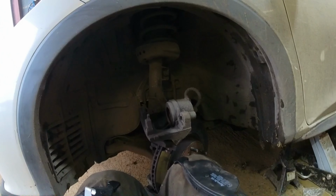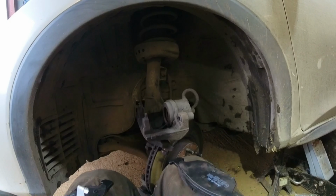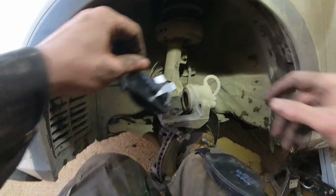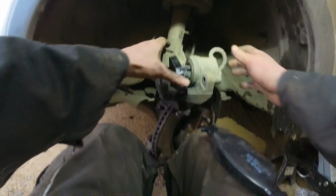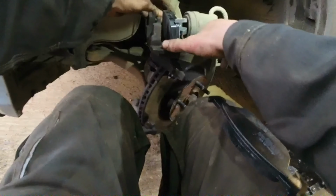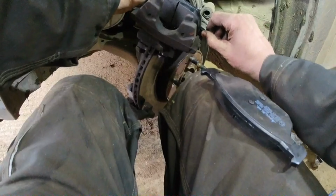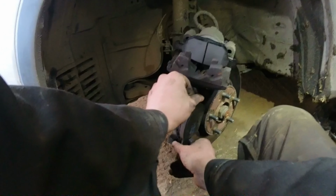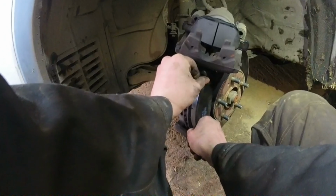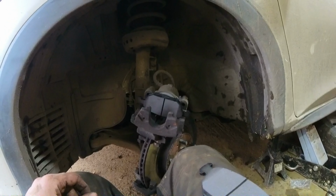So we stick that in. Make sure we have no grease left in our hands. I'm going to avoid touching the rear surface at all. There's one. And the next one is going to go on out here. Just slot in there like that. Make sure it's free. It has to be free because that's floating, and if it's not free, it'll stick on.